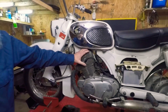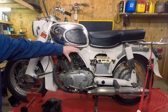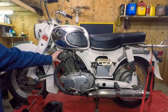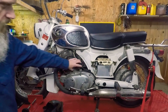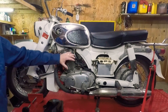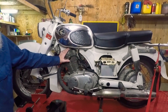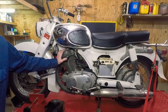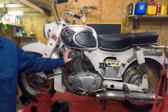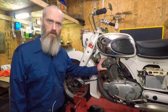The engine's going to be pulled out. We're going to totally strip all the wiring and start all over again — the wiring on it is 50 years old. It's time for an update, simplify the nonsense going on in here, get rid of a lot of the hoses. I want it nice and clean in there, and fix everything that's wrong with it. There are some ignition problems, so I want to put a new set of points and condenser on it. I got some replacement coils I'm going to put onto it.